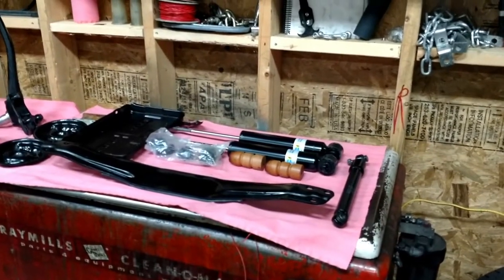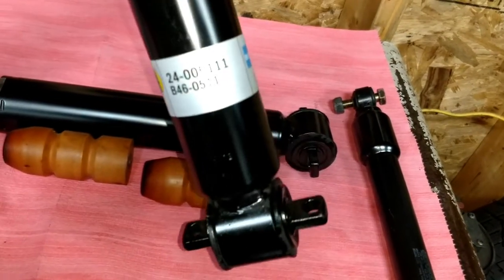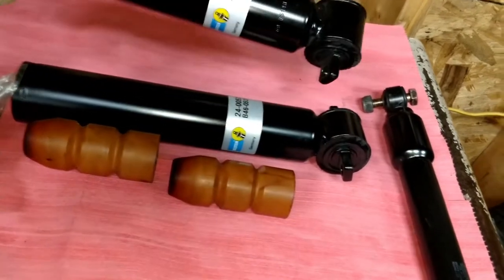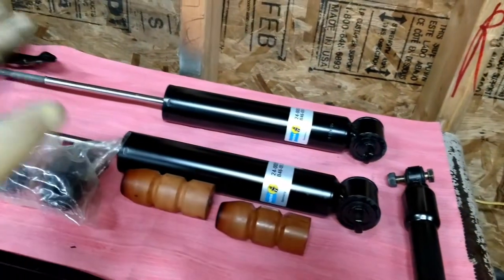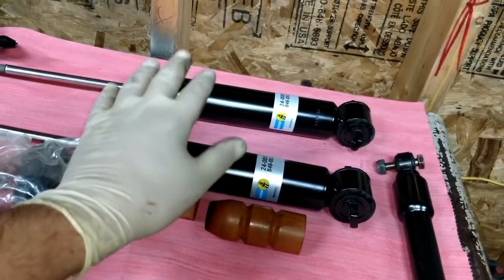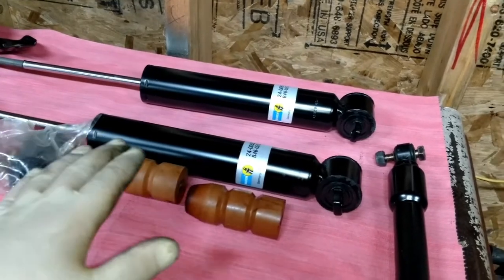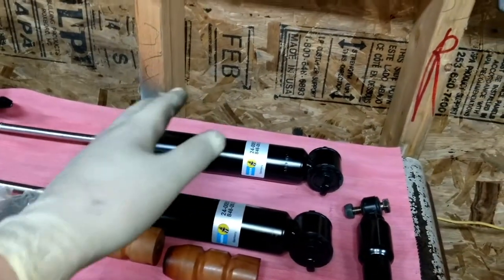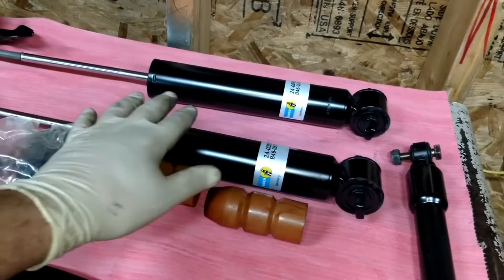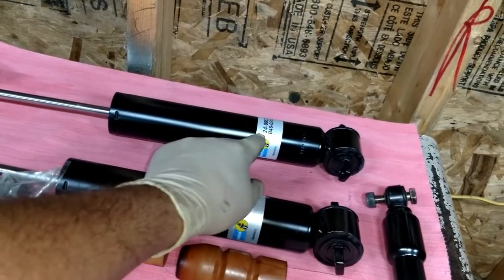One more thing I wanted to point out — the rear shocks did come in. The part number is 24-005111. This is a little bit stiffer shock than what most aftermarket companies will tell you goes on this car, because the ones that Bilstein recommends are too soft for the 300 SD. I think they call it the touring shock. You definitely want to always use these on the front and rear, otherwise you'll get tons of body roll. I've used the other ones in SDs before and was really disappointed with the amount of body roll. These still give an incredibly soft, comfortable ride, but they lessen that body roll because they're a little bit stiffer.